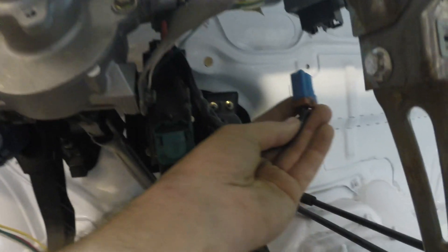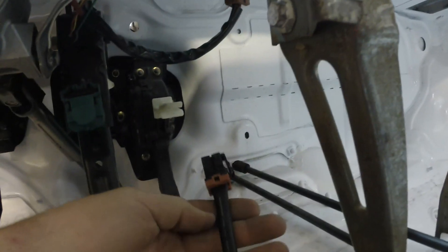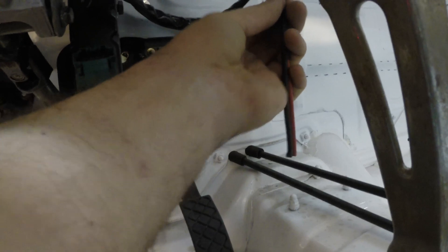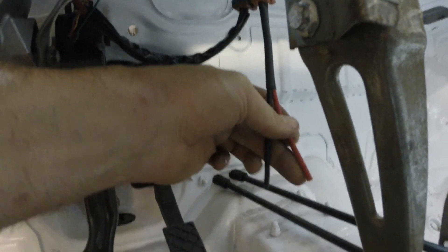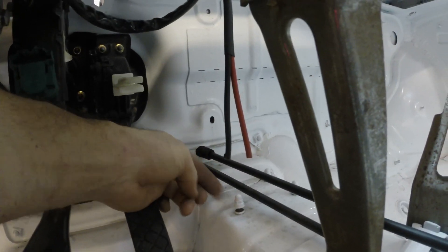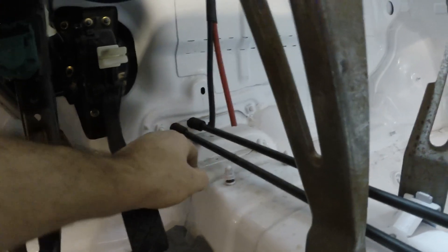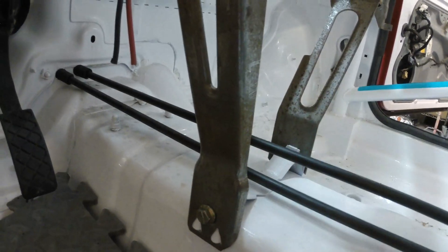This is the main power and ground for the motor and it plugs into the control here. This is the main power and ground for the control unit, and it goes there. This will go to 12 volt power - the battery or whatnot - and this just goes to the ground. Probably go to here actually, since I left the nuts on when I painted it so it's just bare metal - a real convenient spot to ground it. Maybe I'll grind some bare metal back behind here and just ground it straight to the bar.